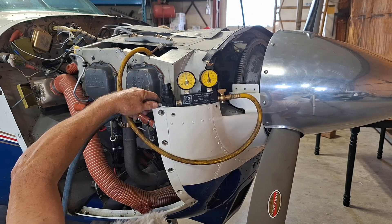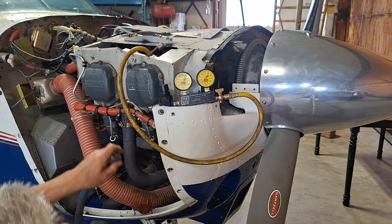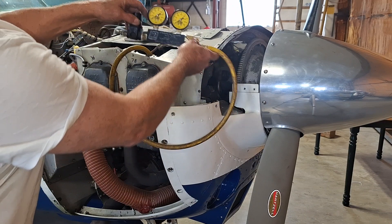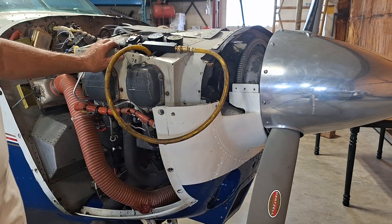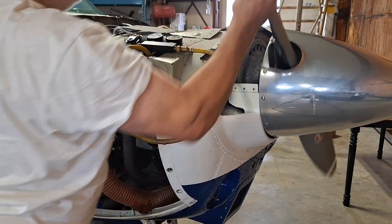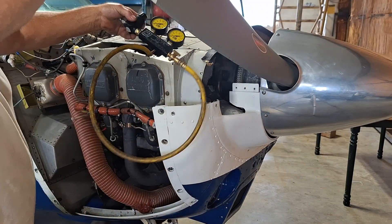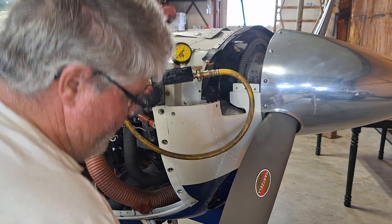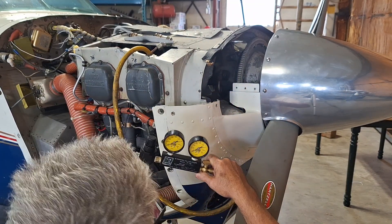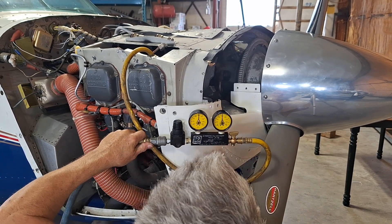After I get to that point I just generally disconnect my gauge and go to the next cylinder. I'm just going to show you what I do on the next one, because I don't increase the pressure slowly like they say to do — I just go around to the next cylinder. Going around, I can hear it coming out of my gauge, I go down to the same spot, I know it's close to top dead center. Sometimes you get two people to hold it; I do it by myself a lot. Just hook it up, the pressure built up fairly slow, and I hold it and get the same reading.